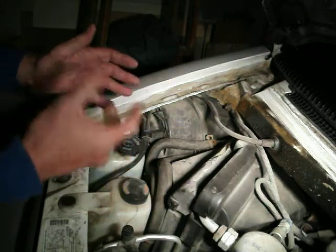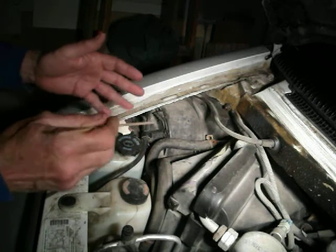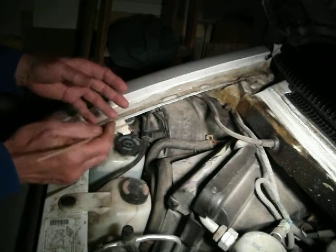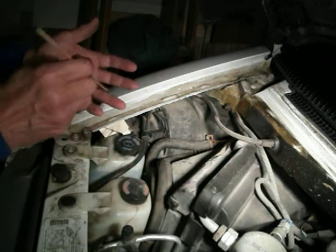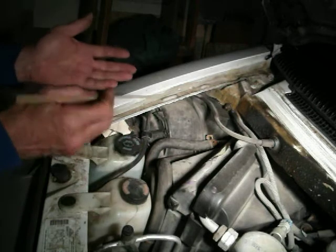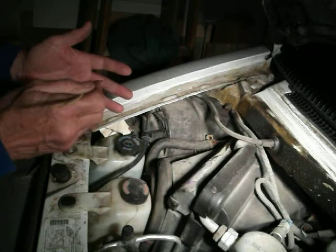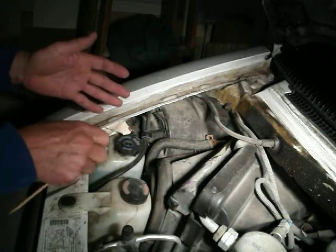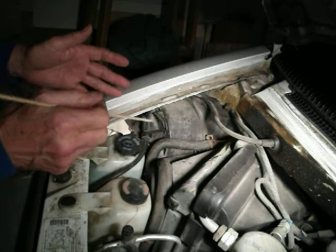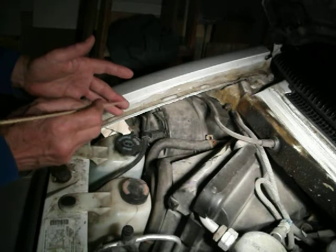Anyways, when you get the back off, the brushes and the front, they have a great big pillow block bearing on the front. Once you've got the back cover off, you can get at that bearing and get some lubrication on it. I did that. The other thing that might have stopped it is the brushes could hang up. The brushes on this were only 40% worn. They weren't even half worn. And this car has like 200,000 miles on it. The brushes weren't even half worn.